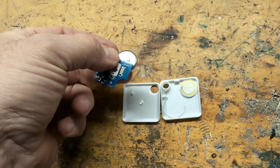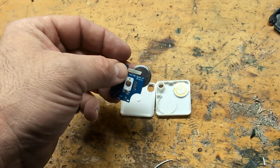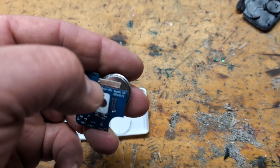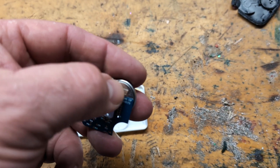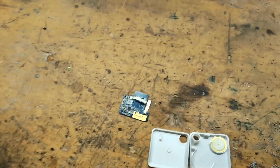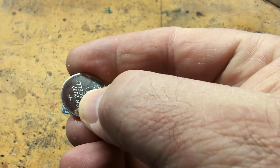Now what you're going to do is take this circuit board — this one I've already cleaned up. This battery is going to be spot welded on here, so you're going to need to take that spot weld off. You can probably do that with a pair of needle nose pliers and yanking at it. If you're careful, the spot weld will release and you'll keep the nickel strip in place. Once you have it off, grab your new battery.